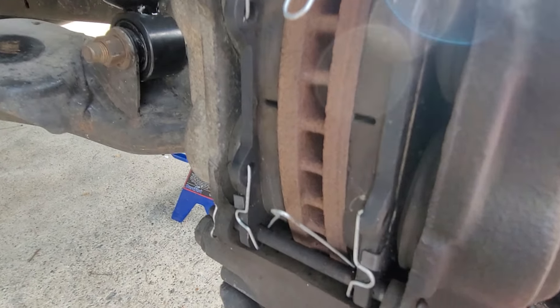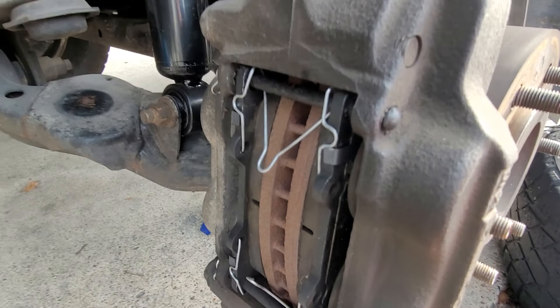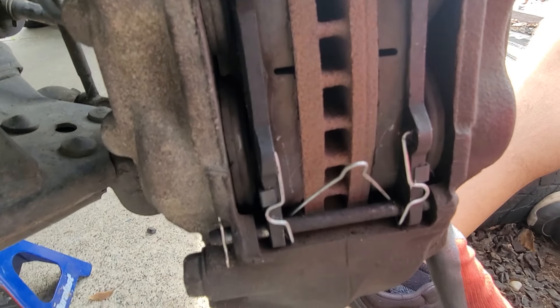That's the final product. Everything is tight — that's how these should be. Everybody forgets to put these in and lock them. People think brake jobs are easy but there are a lot of steps and things you want to make sure you accomplish. After that you can put the wheel back on and everything will sound nice, crisp, and tight. Your car will drive and sound like new — no brake squeal, no rattling, no loose chain sounds. Make sure every little brake clip, retainer, spring, or safety lock pin is in place. It's all there for a reason. I was really happy to fix this on my truck — I hope it helps you out. See you in the next video!